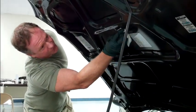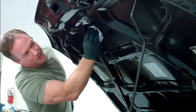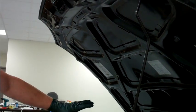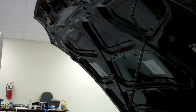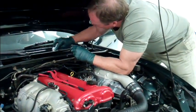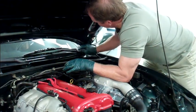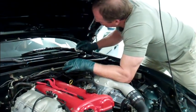It looks like I'm going really fast, and I am — that's the way this chemical likes to be applied. It has a flow-out time that's fairly rapid, so you don't want to go slow. You want to get your coverage complete, get it on fast, and let it do its thing because it has to flow out and settle. If you go back and retouch an area you've already covered, you don't get as good a result — the continuity of the way it flows out will be inhibited. Work from the center line of the car back out, working the cowl — everything is done kind of like painting the floor of a house. You don't want to pin yourself in, so think tactically and don't coat a part of the car that you shouldn't too soon.